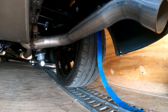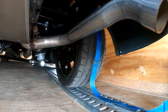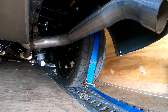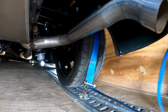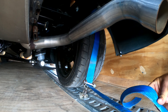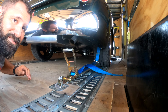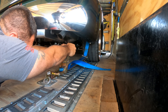It's a pretty tight little area. You always want to make sure on the other side that you get that coupler inside the e-track nice and tight and give it a good yank, because sometimes what will happen is you'll start cranking on the ratchet and it'll pop out and hit the side of the yoke and damage it. This right here protects the strap from coming up when you ratchet it and bending the side fenders. You want to get that as close as you can to that tire — the closer the better — but be careful not to get too close, because the vehicle can shift and it'll be very difficult to get out.